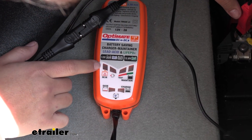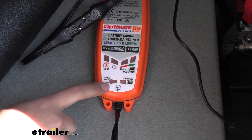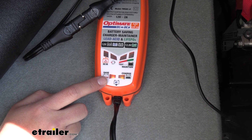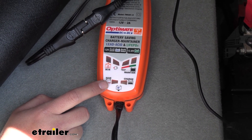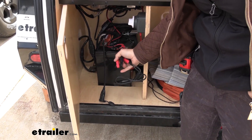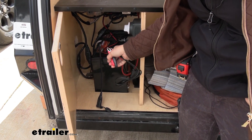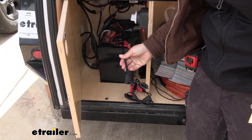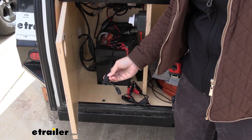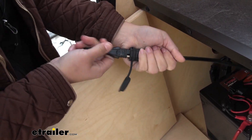Your first LED light will flash for five seconds, then your other lights will blink twice. Then LEDs three and four — the save and charge lights — will flash for a minute, showing that they are ready to connect to the target battery. That sequence confirms the charger is ready to go. In our case, I installed ring terminals for our OptiMate charger so it stays connected longer. Whenever I need to charge, I just remove the dust cap and plug in. Go ahead and connect your ready charger to your target battery.